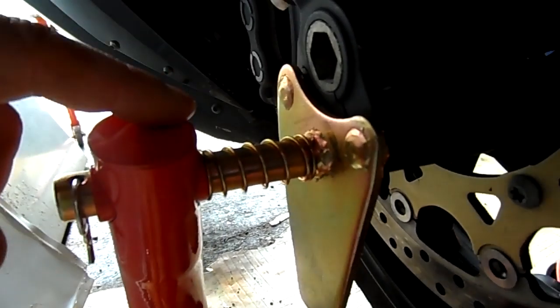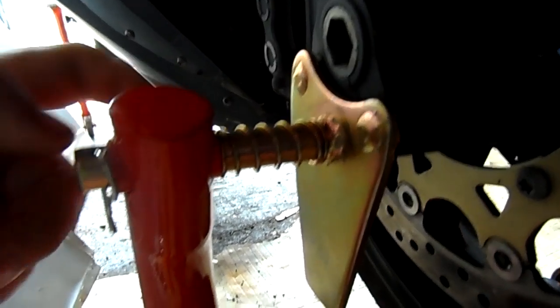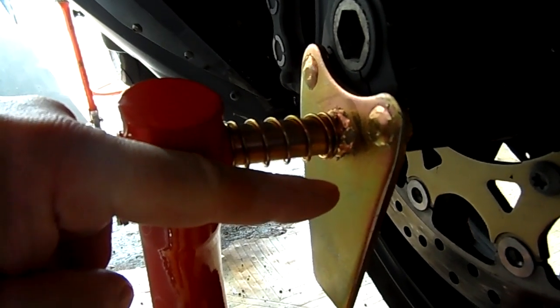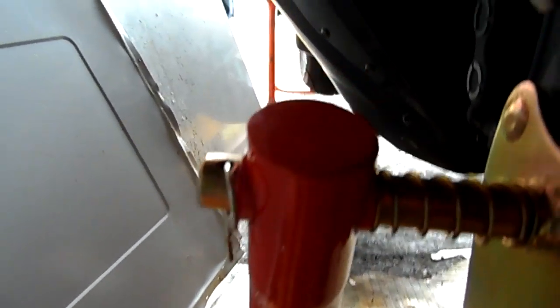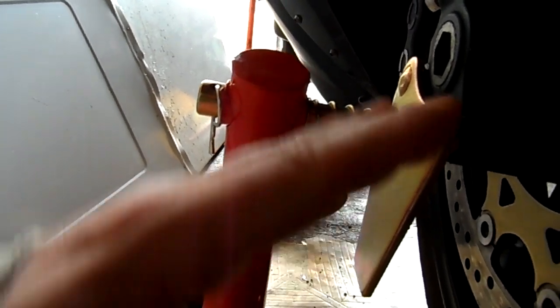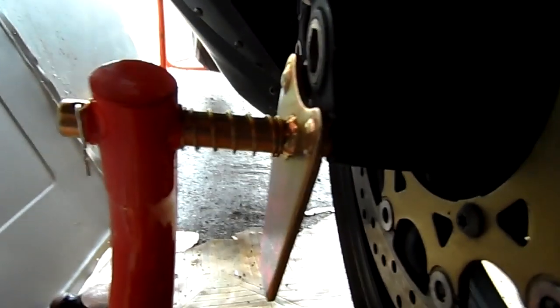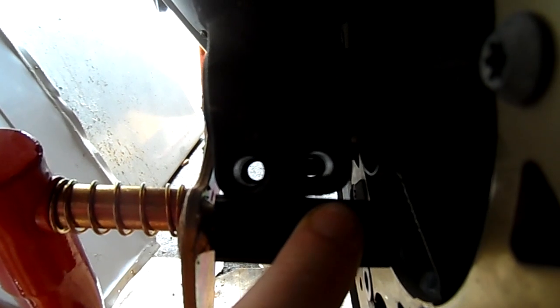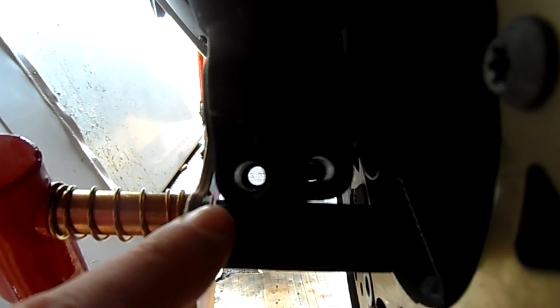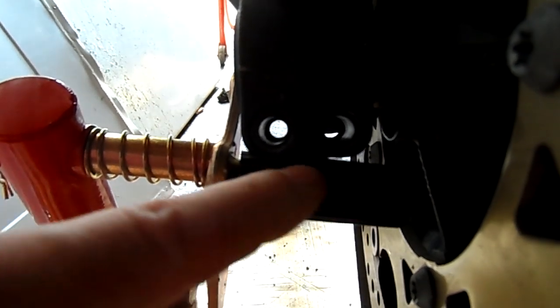Furthermore, when the weight of the bike is on the pins, the UnderFork adapter itself is then also dropping slightly in relation to the sleeve. So it's maybe difficult to see with the camera, but the arm is falling inwards slightly, and then the pinion of the UnderFork adapter is also dropping slightly, which then leads to a situation which you might just be able to see here. You can see the daylight underneath this corner of the fork leg or fork stanchion, but she's tight here. Okay, so that's the amount of slippage that's occurring in the stand.